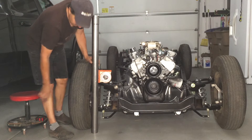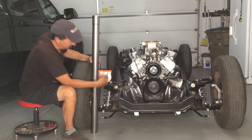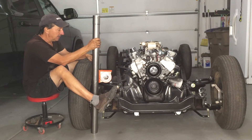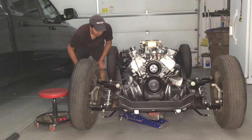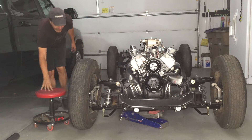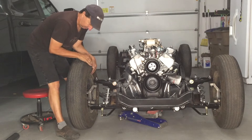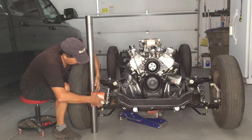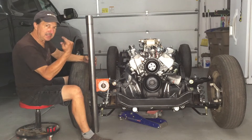What I'm using is just a piece of steel exhaust pipe — I can put it up against the inside of the tire. Right now I'm at five degrees in, so it's way in, not at all what I want. It's just a matter of bringing that out. It's binding up on me, so I'm probably going to have to take the load off a little bit, but I still need to come a little bit further out.